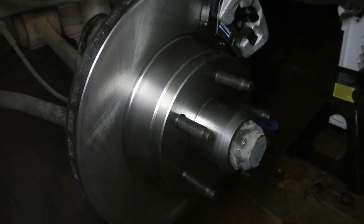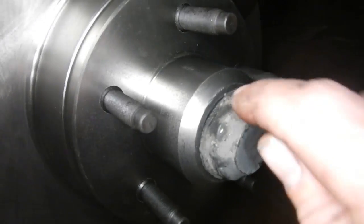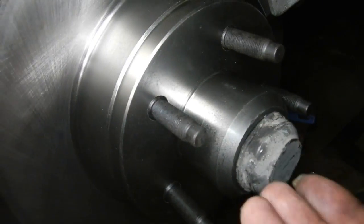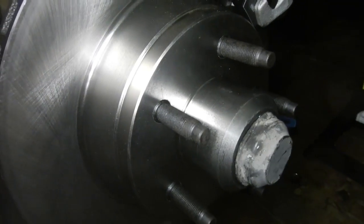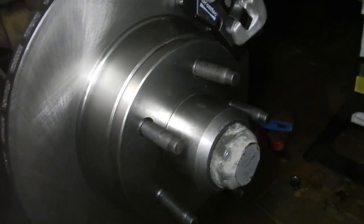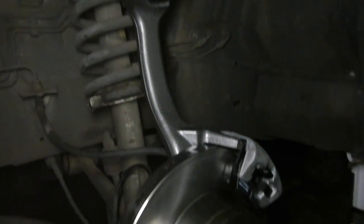Oh, there we go, I'm done. I definitely want to get new caps because you can see how hammered that one is. There's a nice gap. I thought about trying to straighten it, but it's been stretched. Once you try and straighten it, then it goes out of round, and then you're just wasting time. So, cool. Lovely.